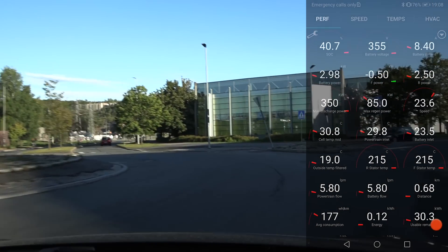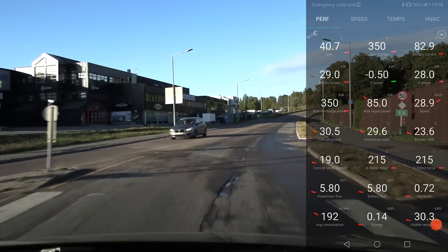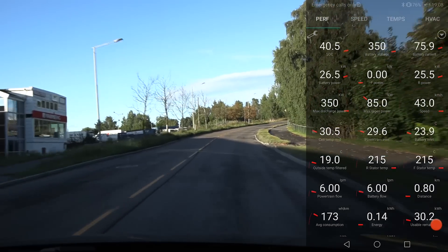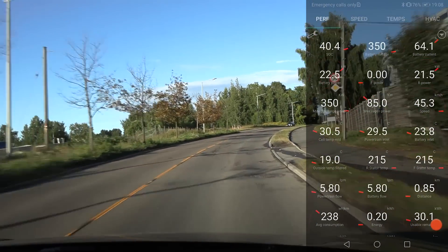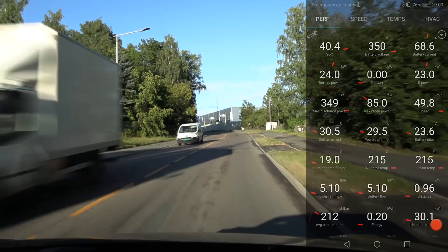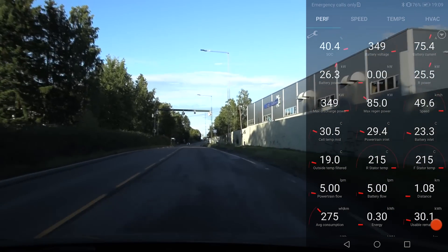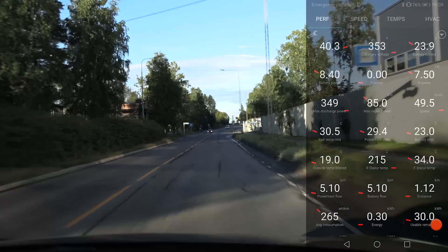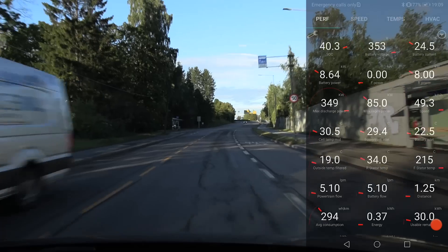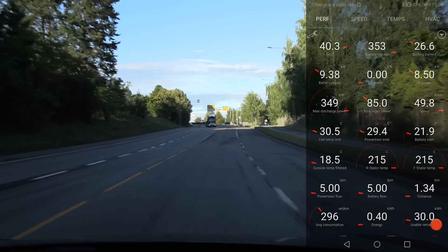So now we're driving. Let's see how far we can drive on that full battery. I reset from home — we have done 750 meters so far. Our drive is kind of slow-ish, going around 50 km/h, and I crack open the windows. HVAC is off. This would be a situation where you miscalculate and don't reach the fast charger, and you just happen to have this EcoFlow with you, trying to stretch it over to the fast charger or somewhere you can charge from the grid. We have to wait until it drops to 29 kilowatt hours, staying on local roads.